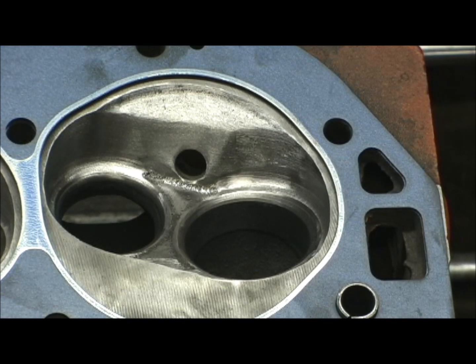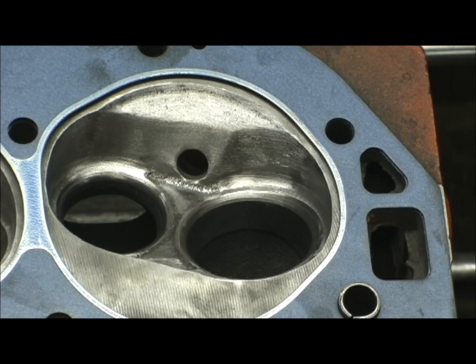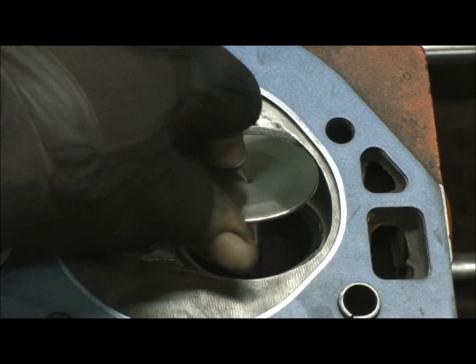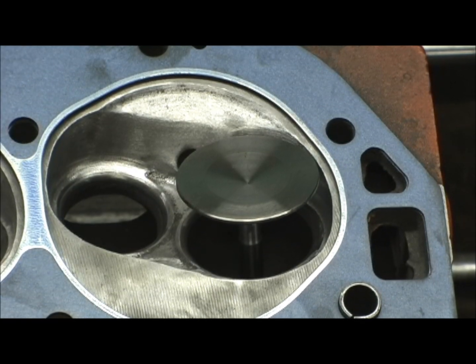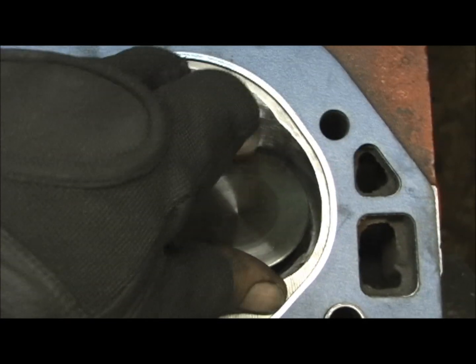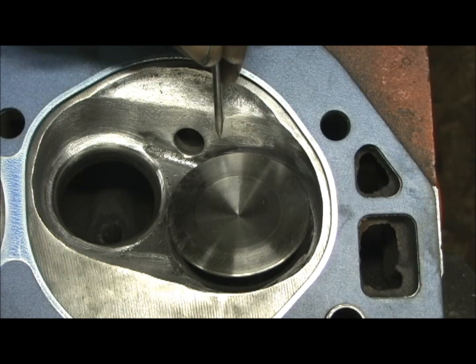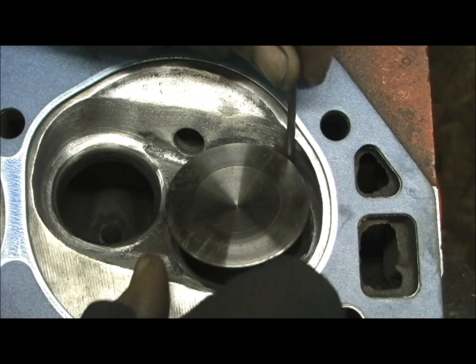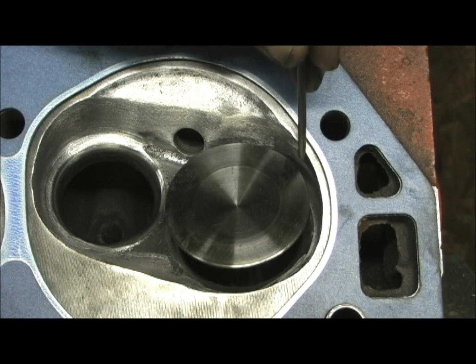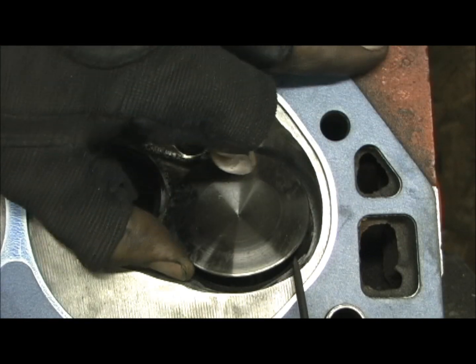When you look at this 2.19 valve, which is what's going in the 396, we've got plenty of room where I've unshrouded it. I've cut it back in here. I actually started here and took the big hump boss where the spark plug was, pulled it back to have plenty of room to unshroud here, and then just tore it all the way and ended the unshroud cut somewhere right around here.